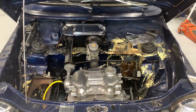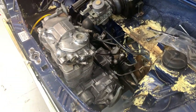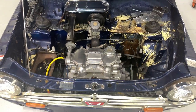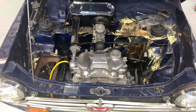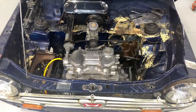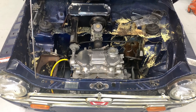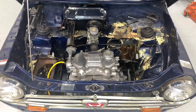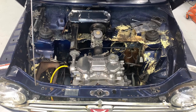Although I know we're going to have some challenges. The first thing that's really going to be tough is trying to get the power from a chain to a CV axle. Also, we can't just put a bike motor in it — we've got a turbo too. I picked that engine up already. The next episode is going to be me going through the cylinder head — it had low compression, so much carbon buildup on the valves that they weren't seating correctly. Hopefully we've got a good motor, and we're going to build some cool stuff for this.